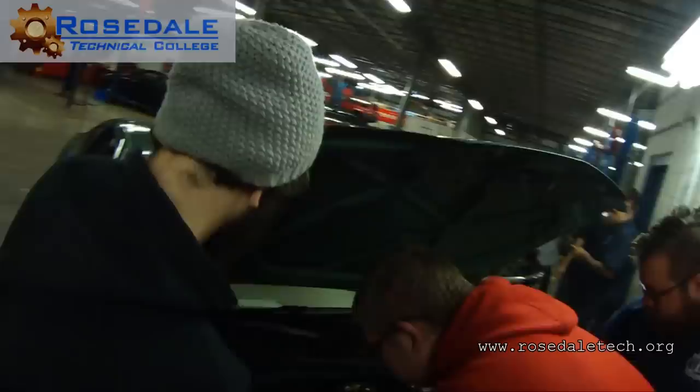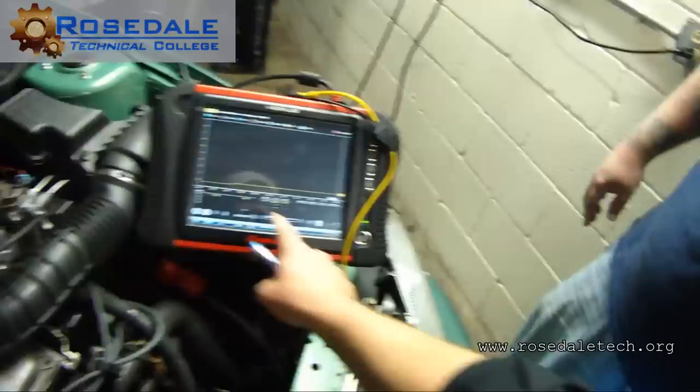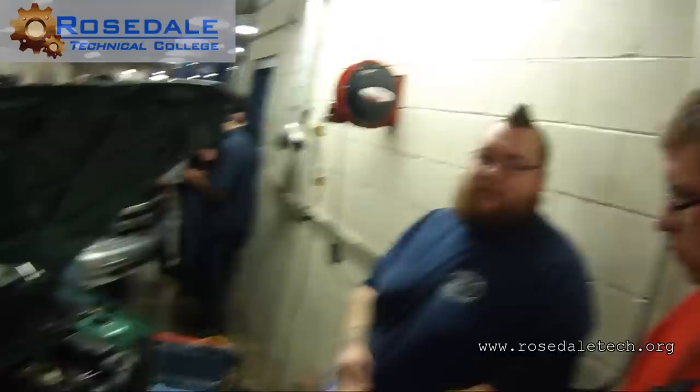And do this too to help us. Let's put our digital signal up there. And where's our negative? Where's our black lead at? I don't like that. You've got a painted surface. Your battery cable's right there. Let's go to our battery. And we were reading negative 22, and what that meant is the battery actually has a better ground than where you were connected.